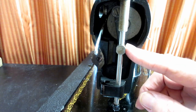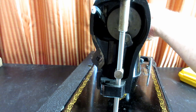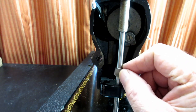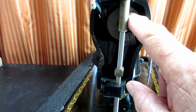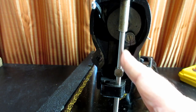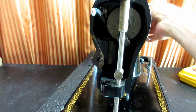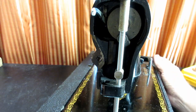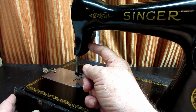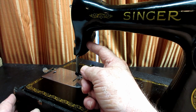To do that you're going to put the needle bar down to its low point. This needle bar connecting link that connects the connecting stud to the thread take-up cam should just be straight up and down, parallel with the needle bar — that puts the needle bar at its lowest point. At that position, when you look in the hole behind the nose, you should see the head of the set screw sticking out of the back of that connecting stud.